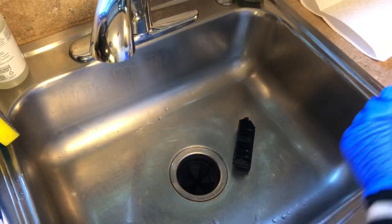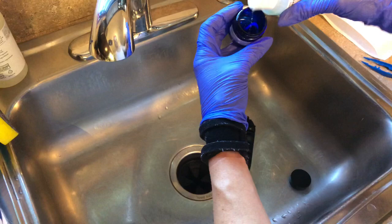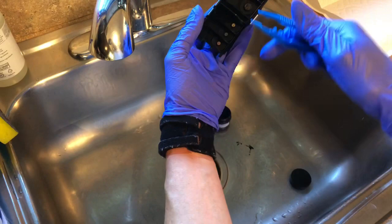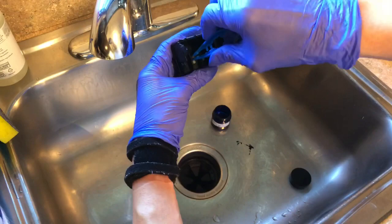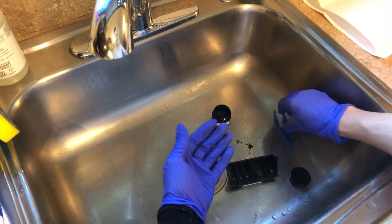To start off, I'm going to take the tweezers and this little container, pour a little bit of this print head cleaner in there, and I actually mix it with a little bit of water. There are these little rubber black pads on each of the sections here, so I want to remove all five of these pads with the tweezers — just pull it off and then drop it in the little container. Do that for all of them, then put the lid on this jar and set that aside.